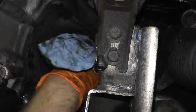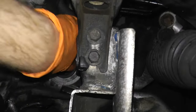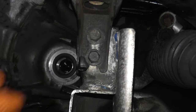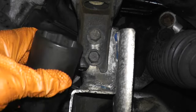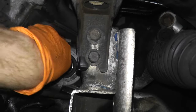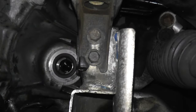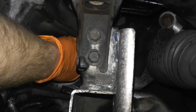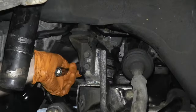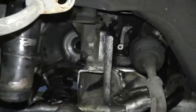Now you want to clean the area the best that you possibly can. There are two ways to install the new seal. You can use the same 36mm socket from removing the axle and lightly tap it in — it's very, very tight. Or you can use the old seal: place it around the new one and lightly tap it in. It doesn't need a lot of force to get in, fortunately. So the new seal is in there.